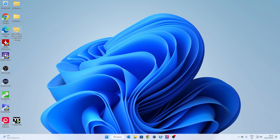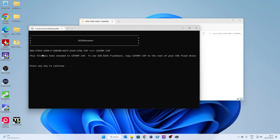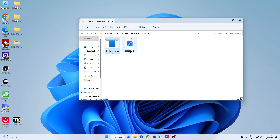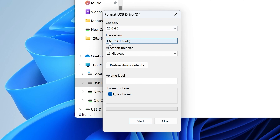On the desktop we've got our ROG Strix Gaming Wi-Fi BIOS file. We're going to Extract All to the desktop. Now it's really important — you do have to rename the BIOS file so that USB Flashback can recognise it. Double-click the BIOS Renamer .exe and it will say the file has been renamed for USB Flashback — press any key to continue. The filename has now changed. Plug in your USB drive — it will need to be empty. This one has a previous flash on it so I'll format it. Right-click, choose Format, FAT32 is the default which is fine.